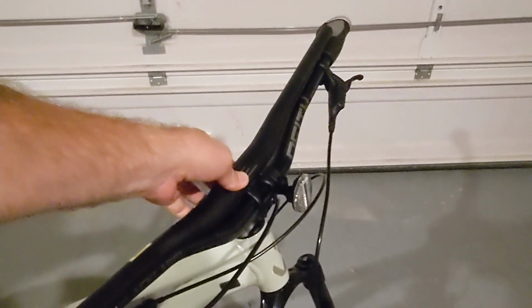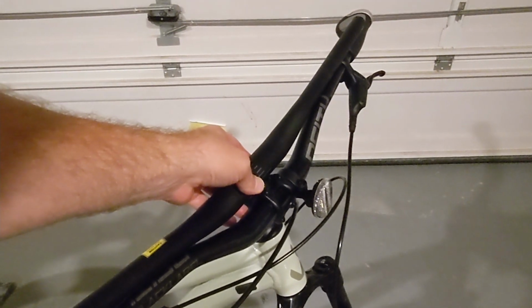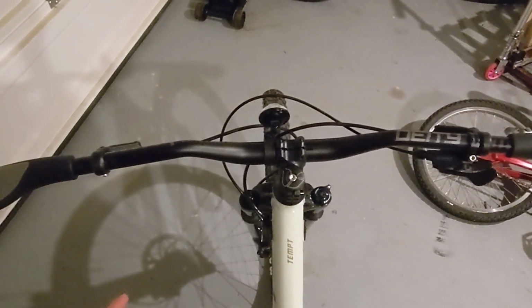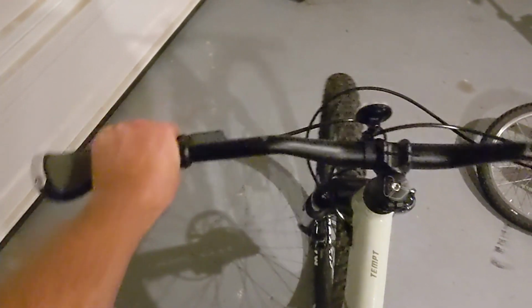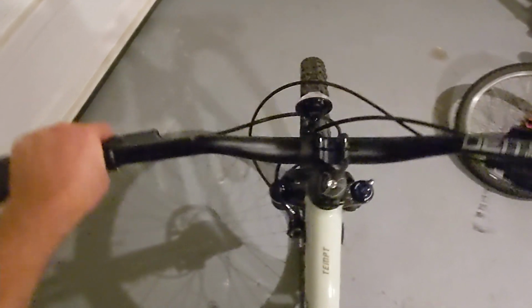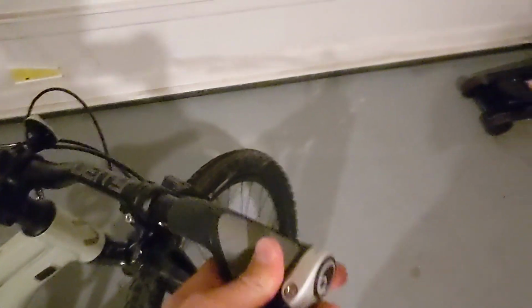So I don't know if I'm going to be able to get it all in frame or not. And maybe I can sit these and they don't fall and make a bunch of noise. But that's basically the difference we're looking at. And that makes such a big difference because when your hands are more inboard, the same degree of movement results in the tire making larger steering corrections. And what that ultimately means is when you're on the trail, you're able to be more stable with the bike.